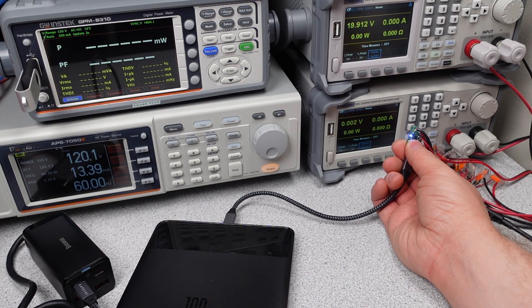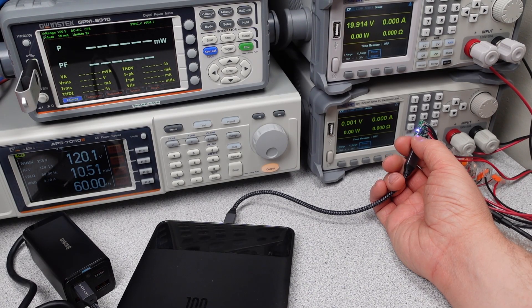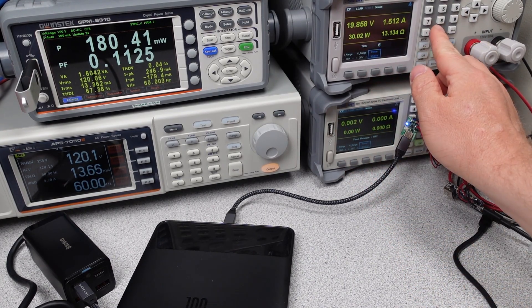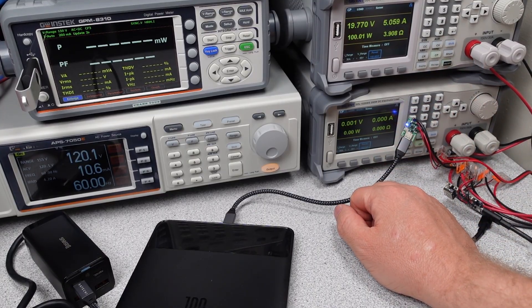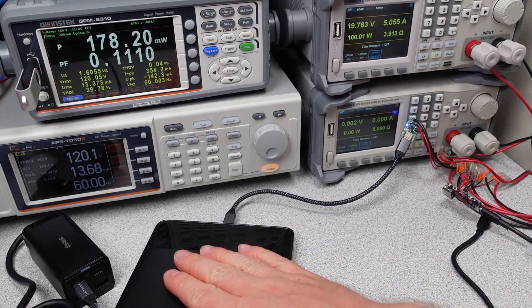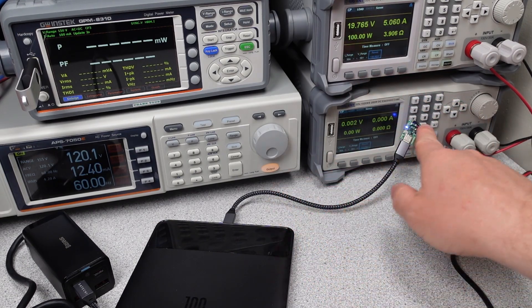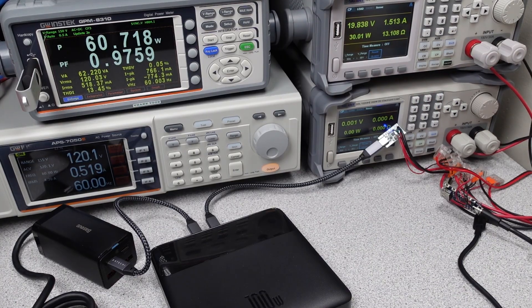The other mode available is PPS, or Programmable Power Supply mode, which varies the output voltage to maximize your charge efficiency. This device offers a PPS mode of 20 volts and can go up to 100 watts — not mentioned in the user manual. It should be able to do 5 amps and 11 volts to support Samsung super-fast charging. With all ports used, all ports are 5 volt only. The renegotiation of power is aggressive on this device — plugs and unplugs trigger renegotiation of other USB outputs — though this is acceptable and expected.